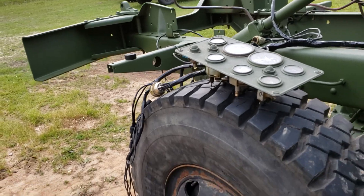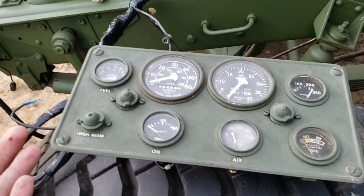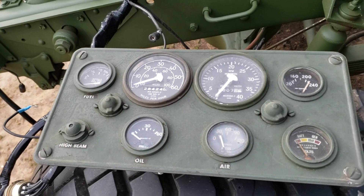Hey guys, I've got the wiring harness all done up the way I want it. I'm about ready to run all the stuff that goes back through the firewall into the dash. I want to show you how to wire the cluster, and you can actually do this completely without a wiring diagram, a schematic, or a TM that tells you which wires go where. I'm going to show you why. I'm doing this out here because it's easier to work with the wires when they're not up in the dash.